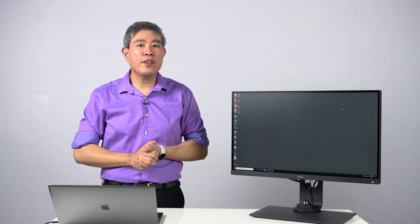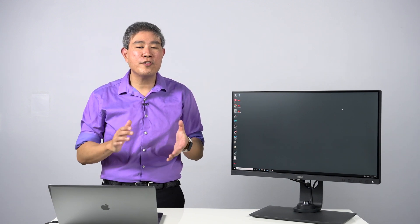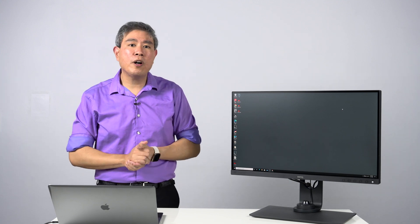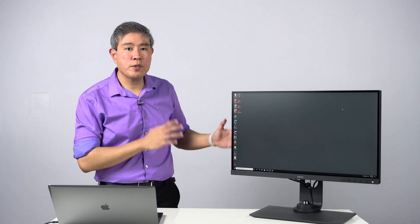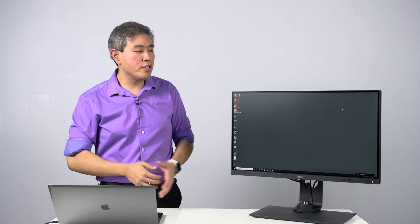Now that I've switched over to Windows, I'm going to show you how you can apply method number two in Windows 10. Keep in mind that if you don't have all the ICC profiles on your system already, it may be a little involved initially to get everything set up. However, once you have it set up, it's fairly easy to come back and change it in the future. First, I want to change my BenQ display to the hardware color mode I want — in this case, Adobe RGB.